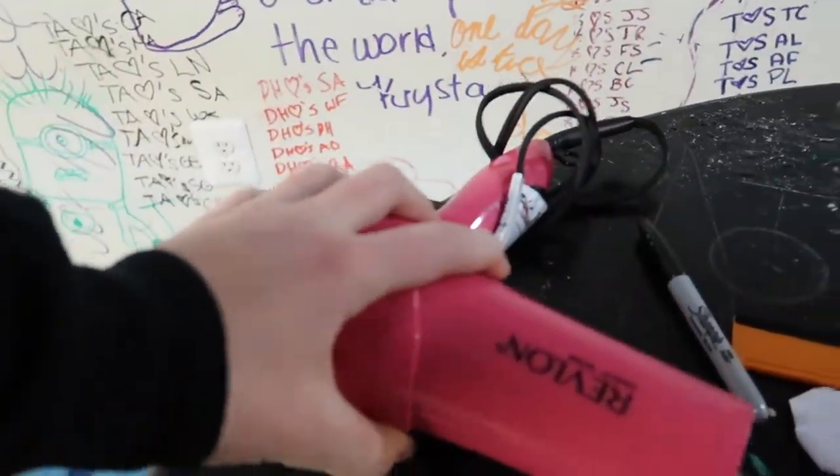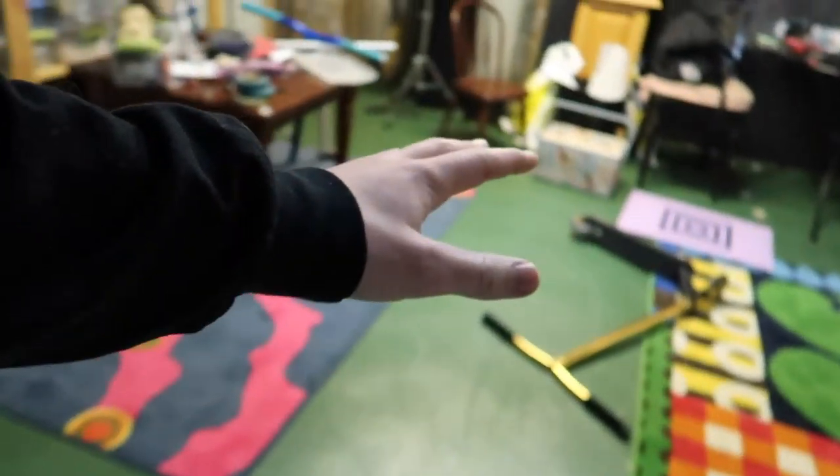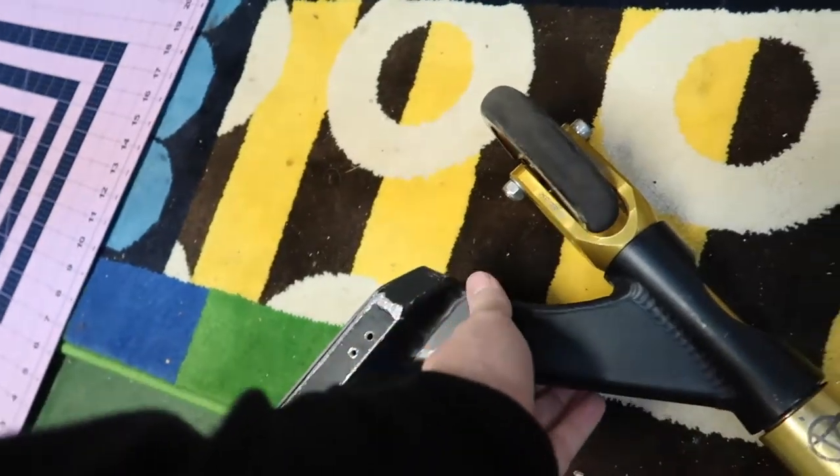Let's get into this. Step one: wash the part that you are going to wrap. Get your materials — get whatever kind of wrap that you want. I have gold because I want gold. Get a hairdryer. Then you have your scooter part that you're going to be wrapping. For me it is my deck, and wrapping your deck is definitely gonna be a lot easier than wrapping your bars or your fork, just because it's large and square. I'm going to measure out pieces to fit on my deck — one piece from all the way here around the deck, and then I'll do the head tube as a separate piece so it looks better.